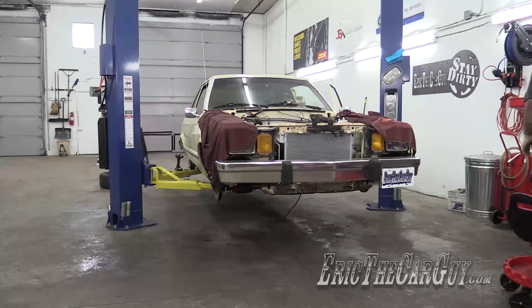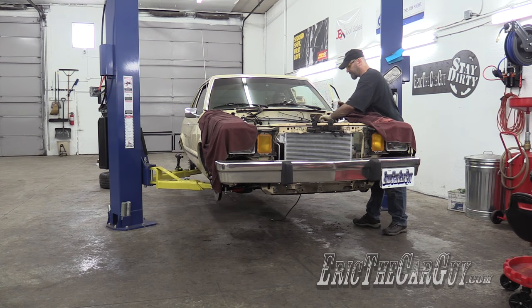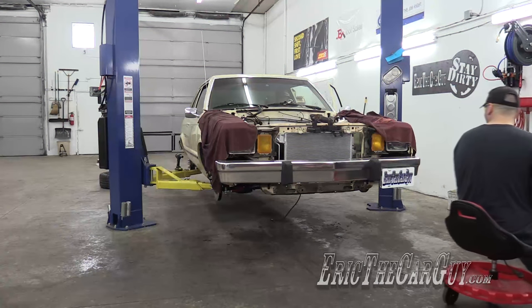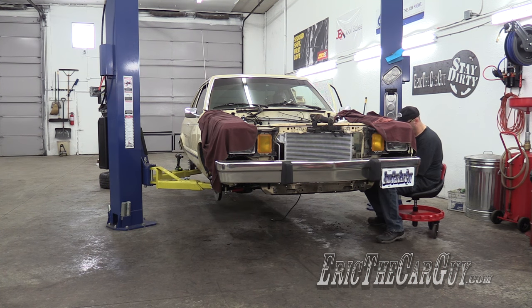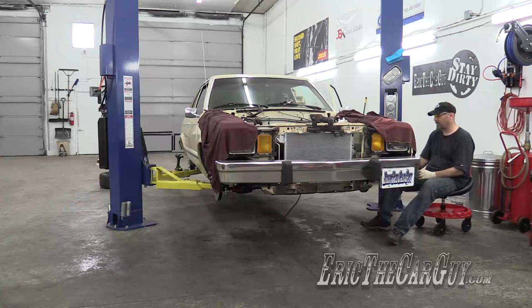All of a sudden there was like — massive. What happened is it's working. We're so not used to it. Pump it. How's the brake pedal? Now it's gone. And then it nosed up, and now it's massive. So there's air in there somewhere — it's probably towards the back, because we did have that system open for a while. But most of the stuff in the front is gone. Pump it. Hold it. There's a lot there. Pump it. Hold it. How's it feel? Once you get it built back up, it's a brake pedal. But you've got to get it pumped up.